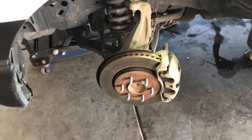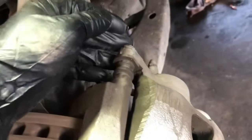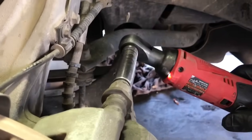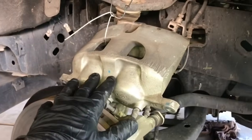After we do that, take off the wheel, jack up the vehicle using properly rated jacks and jack stands. Once you have that done, we're going to remove the caliper. You'll notice there are two bolts on the side of the caliper — those are the caliper mounting bolts. We need to remove those and properly mount the caliper away from the rotor so we can remove the brake.